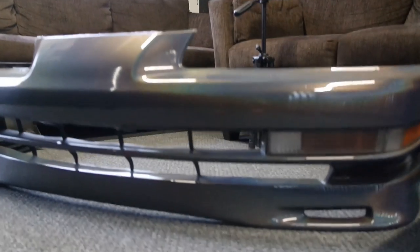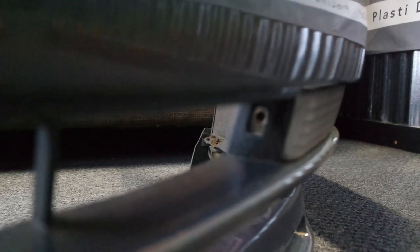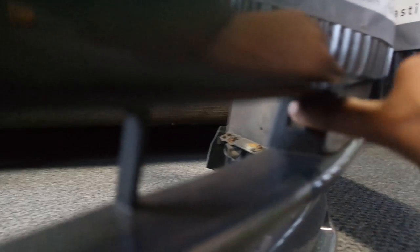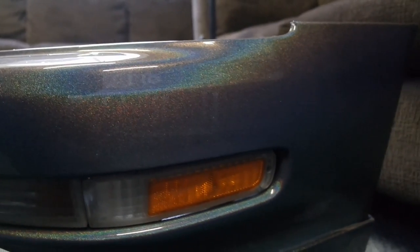I went ahead and took my bumper off. The next thing I'm going to do is get the old turn signals out. If you've never taken the turn signals out before, it's not too hard. The only thing that makes it hard is if these bolts or screws kind of seized. But if you look carefully through here, you can actually stick a Phillips head through this hole and unloosen this. Once you unloosen that, you come on the side — this outer one also has a Phillips head. Take that out, and then basically these are like slide-in, slide-outs that lock in place. I'm going to get these screws out and get these old ones out, and then we'll start fabbing up the new ones.